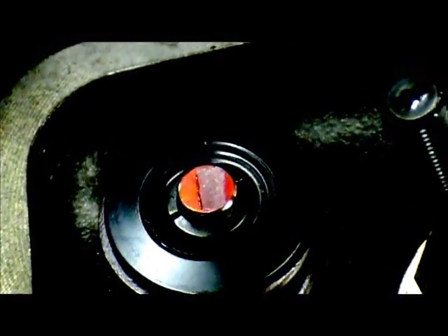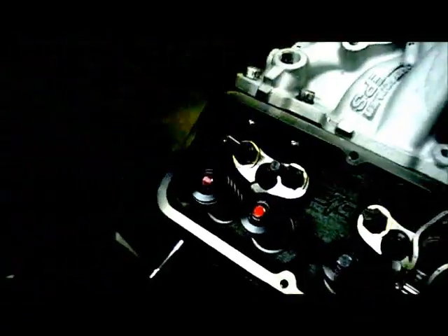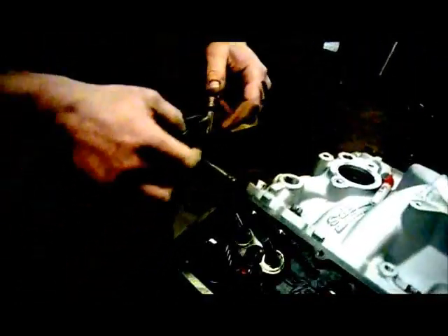Where you want that pattern is right in the center of the valve. This one has moved off towards the back, so we need a longer pushrod. You need to check every one of them. I've had instances where, on an old shitty set of heads where the valves are sunk and the customer doesn't want to put seats in, sometimes I have to use two or three different lengths of pushrods to make it perfect. Now let's check the intake side.